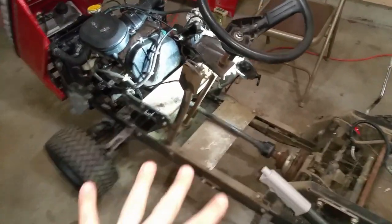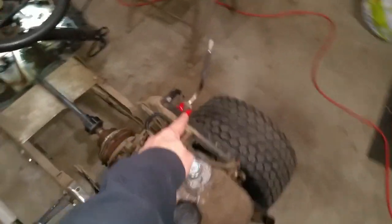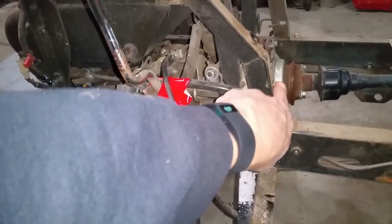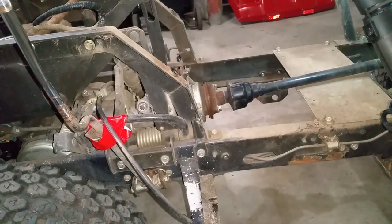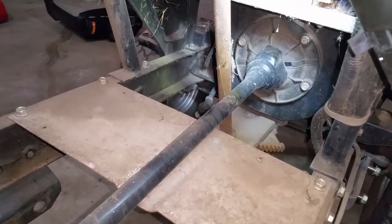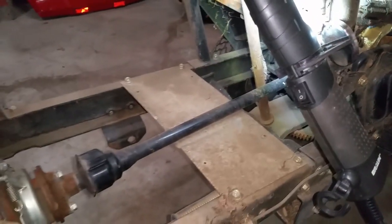A few other points when taking apart the foot plate: I did remove the battery since I was going to have to anyway. The gear shift column will need to be removed — I put some tape on it, it's currently in neutral so it doesn't hang down. It's held in by a 12mm bolt here and a 10mm bolt right here. You can put them back into the stud so you don't lose them. In comparison to the 45-14, this is going to be a lot more straightforward once I remove the battery plate. It doesn't look like I need to take out the entire pedestal, which is great. That squeaking is definitely coming from the front damper, and I can almost guarantee it's going to need to be replaced.